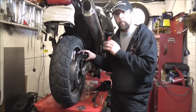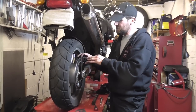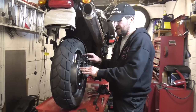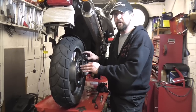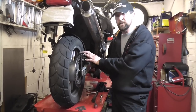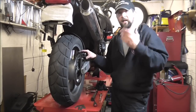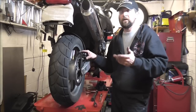Obviously the soft copper itself as a metal is softer than the stainless steel disc, so it's going to wear first — but that's not always the right thinking. It is believed that a soft compound, if enough time goes on, will wear the discs. I've found that when I've used sintered pads in the past I have suffered a little bit more disc wear. However, they are better — with that extra friction rating you don't need to brake so much. So if you're going to fit sintered pads, adjust your braking accordingly. I don't mean brake late or brake like a race bike — I mean brake just a little bit more sparingly. Think ahead, read the road, use the brakes when you need them and use the engine braking when you don't. That is also better for fuel economy, tyre wear, and everything else.